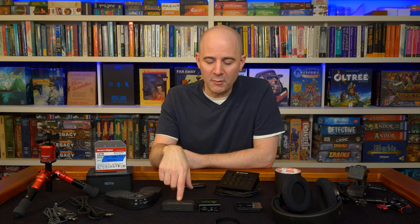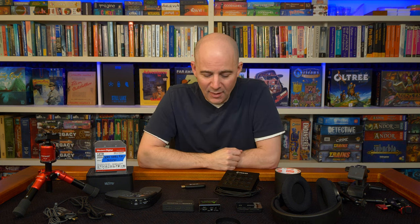I like the powered ones, so I've got a power strip in the cabinet that's powering all these switchers and splitters. I use a bunch of these to give me flexibility of what's shown on each monitor. For example, the front monitor has switchers that allow me to switch between showing me the direct feed from the front camera in 4K, or showing me the output of my PC which is 10 feet away, so when I'm live streaming I can see the OBS output, all the stats, or when I'm using an ATEM Mini I can switch to that. Having these configured means I can control what gets displayed on each monitor and change it depending on my needs.